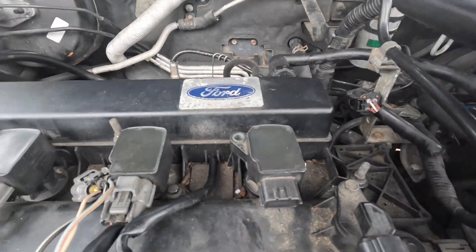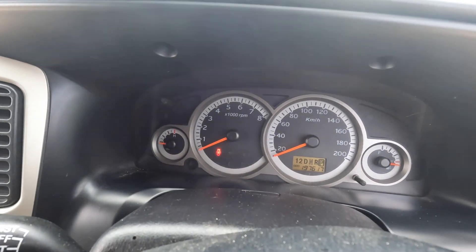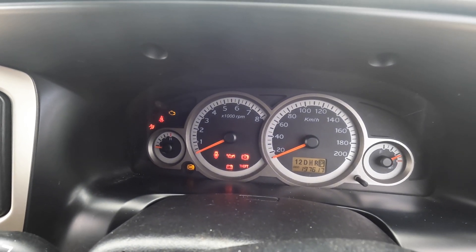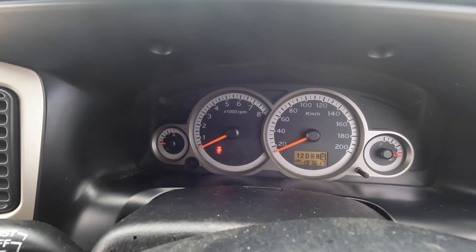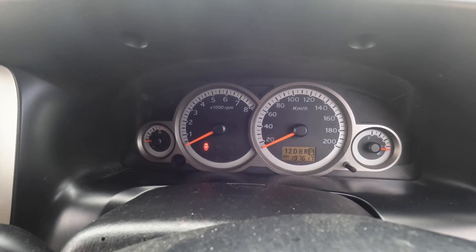So we pull out the test circuit, get ourselves a new 10-amp fuse, make sure we've got the right one, and pop it in. With that lead disconnected and a new fuse in, we get the noise — car starts, runs like crap because it's only on three cylinders, but we've absolutely isolated where that problem is. The engine is running, so that's all good.